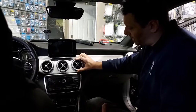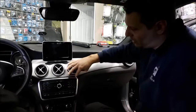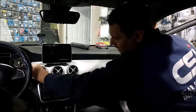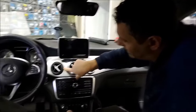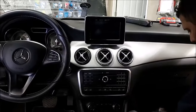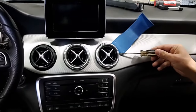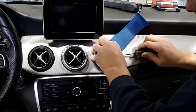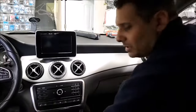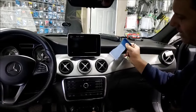As you can see this one is closed — it has to turn left and then it will come out, same on this side. When it comes out you'll have it like this. There's a tab in each corner that's holding it from turning. My trick is putting a plastic popper there, then with a screwdriver I reach to that tab, press it down, and at the same time I'm turning — and it opened. Very simple, very easy, no scratches on the dash. The reason you don't put the screwdriver directly is you don't want to scratch, so the popper gives a little height.